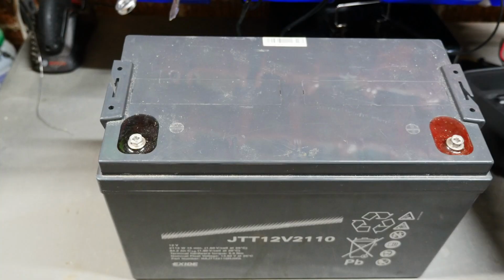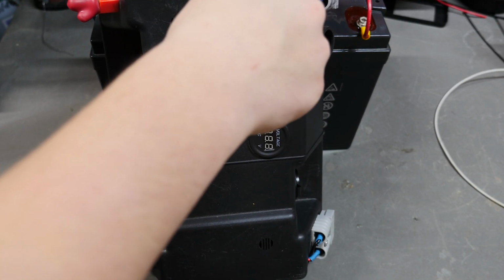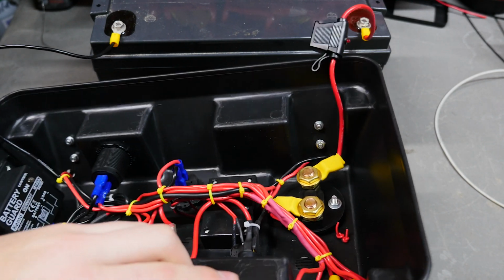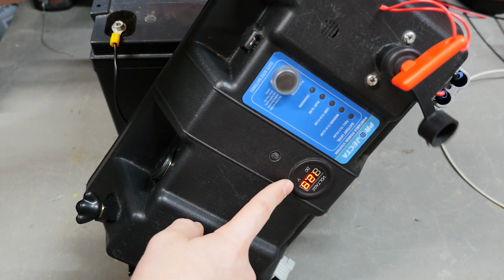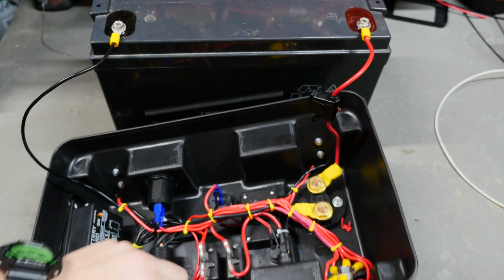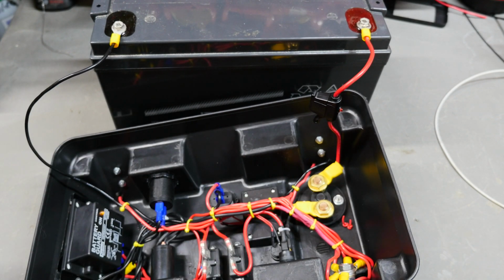So, it's incredibly heavy. Nothing's heating up yet. Nothing's exploded yet. I will turn on the isolator. The voltage cutoff takes a second to read and switch voltage. So you'll see this light will come on when the cutoff is on. So it's being controlled. Up front, should see voltmeter come on. It's around 12.9. That works perfect. Nothing has exploded yet. Again, nothing feels hot. Nothing should. There's no black or red on the wrong terminals.